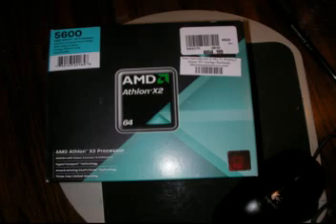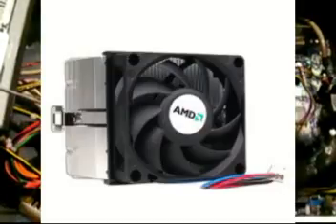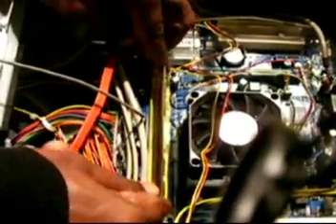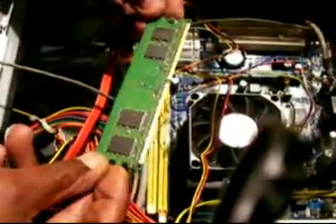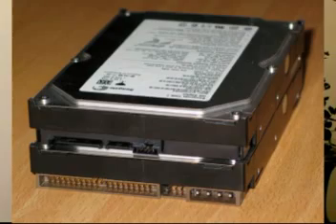The most important thing here is to have a processor. I have my processor here — I'm going to show it to you. It goes here with a big fan. Here is the memory; the memory goes over here. This is what a memory looks like and fits right here. Then this is where your power supply connects to. IDE cable, SATA for your hard drive. You would have an IDE hard drive or SATA hard drive — I'll explain that to you later.